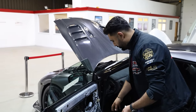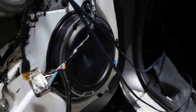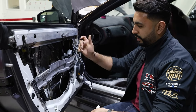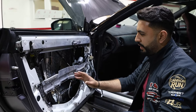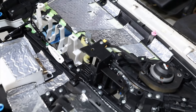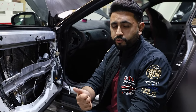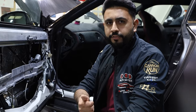Inside here we've got the speaker itself, which is the 6.5-inch speaker, and then we've got the 3-inch, which is actually mounted inside the door. We've now acoustically soundproofed the back of this panel — it was literally just one sheet in each door before. Now every pretty much inch of it is covered. Then we've got the membrane to cover, and then the back of the door card. There was zero soundproofing on the back of the door card. This is applying to all the key areas across the door, making the door a lot more solid, reducing road noise, and building a far better acoustic environment for the new speaker system to work in.